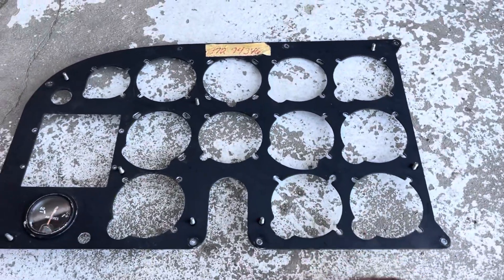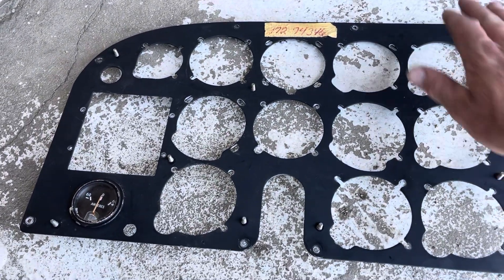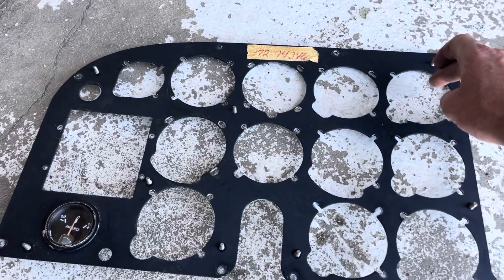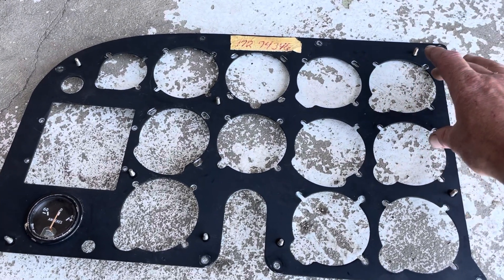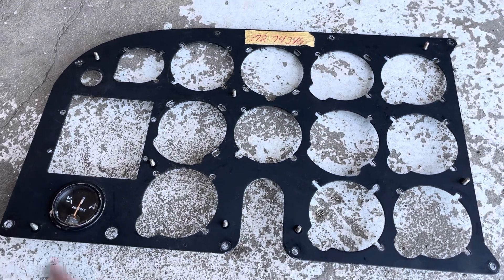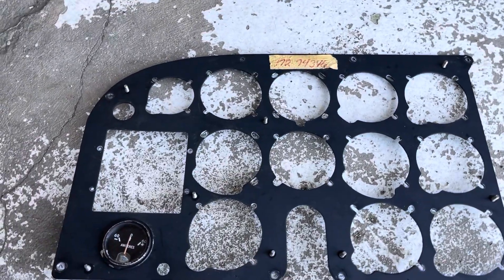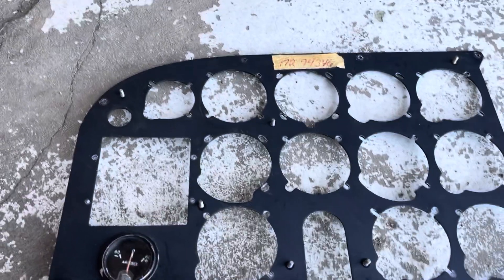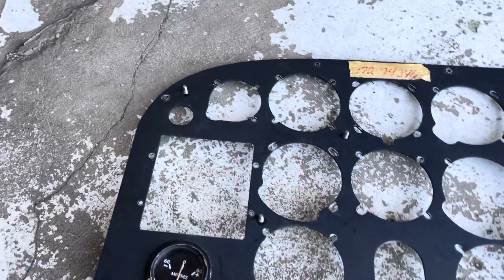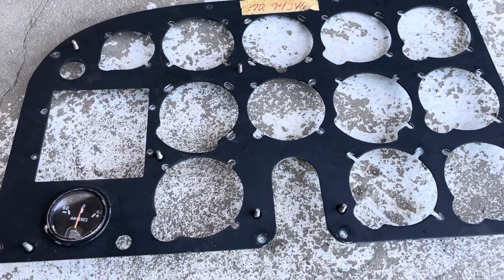This panel that sits behind the plastic panel is going to be recut to remove some of these holes, so they'll just be neatly blanked over. There was a NAV1 and NAV2 CDIs there, which of course will both be put onto the 275. A few things won't be recut and will just be made nice and clean and blanked. The engine instruments will still all go here — that stays. The suction gauge can go because we're not going to have it anymore with the VAC pump being removed.